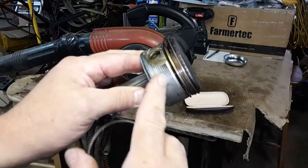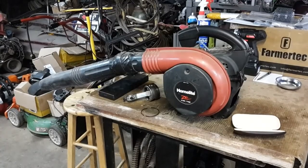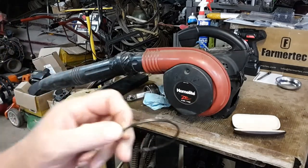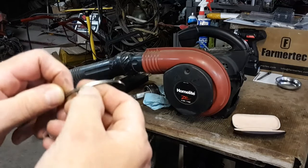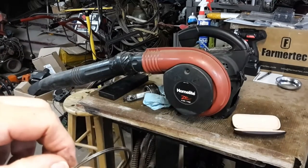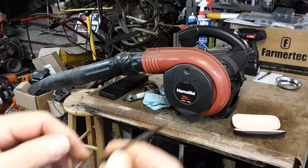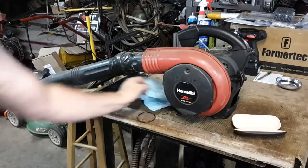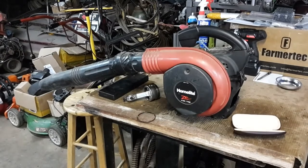The piston, you can still see — looks like I filled up my SD card. But anyway, as I was saying, the ring for that Briggs & Stratton is just completely worn out and it was letting a lot of oil bypass it. And that's what was causing it to burn oil. So I've got that in the works and I've got parts coming for that.